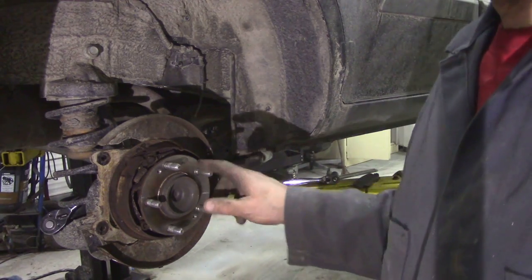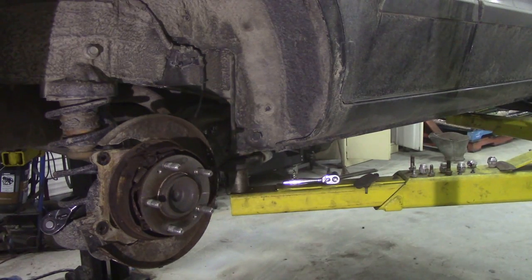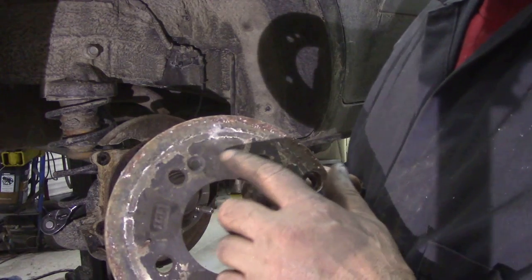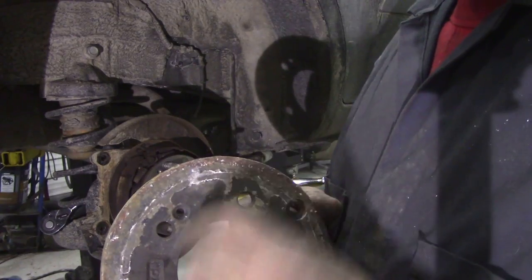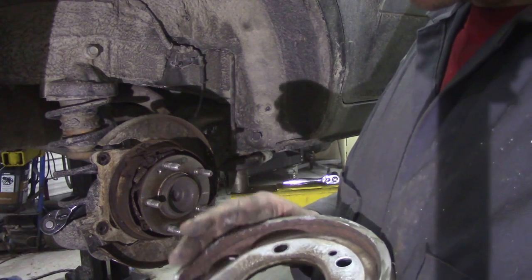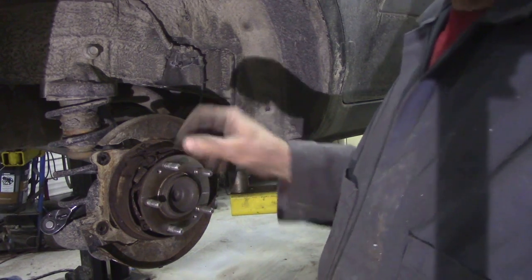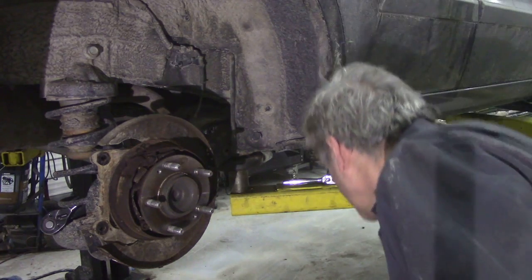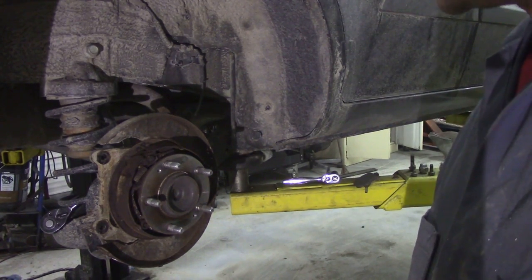Unfortunately, some of these sort of brake drums, and if you've seen on Land Rovers, they've got a little tapped hole here to jack off the thing. Well, I couldn't tap them because I'd end up drilling through this bit too, and there's not all that much meat on those to put a thread on, so the grinder was the only option. Right, we'll have to wait now until the parts come.